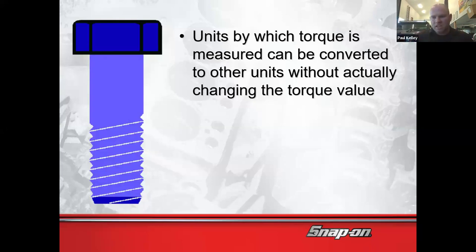For example, if it's a Toyota Yaris, it's probably going to be less than, let's say, a Toyota Tundra, right? Tundra is going to have more weight, more force, bigger tires, bigger rotors, bigger brakes, bigger stuff. I would anticipate it's probably going to have a higher torque spec on the Tundra. The bolt's probably also going to be larger, by the way. So when we start looking at the bolts, these bolts are sized for the amount of force that they're going to encounter. But additionally, when we bolt two things together, essentially we're attaching them. And when we're torquing, this bolt is going to stretch a bit and it's going to clamp the parts together with a certain amount of force.